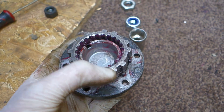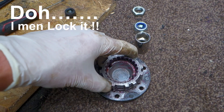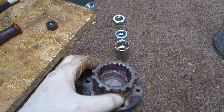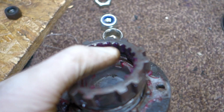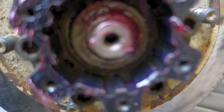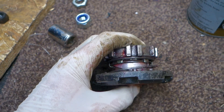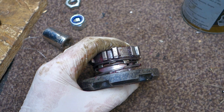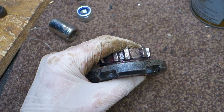There's your guide and there's your locking teeth. Let me show you - when you unlock it, it kind of springs out, you can see. It runs on some chambers or runners. Those teeth lock onto the shaft. When it's on free, it's not engaged onto the shaft. When you lock it, that springs out, locks onto the shaft, gives you drive to your wheels. So that's free, that's lock.